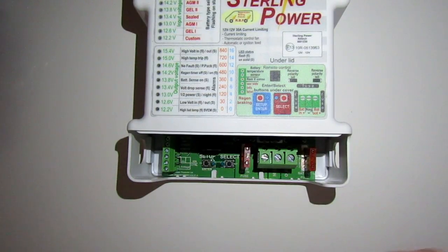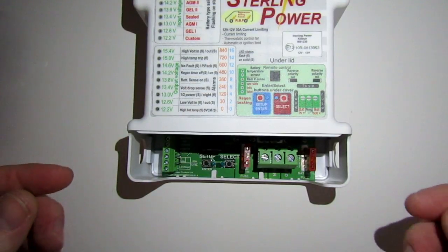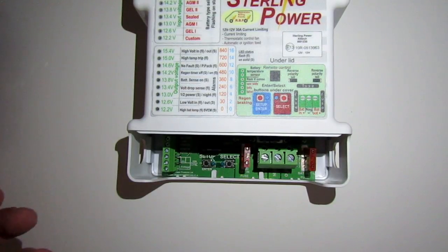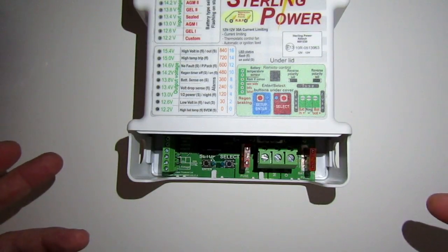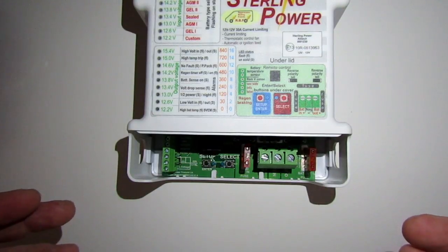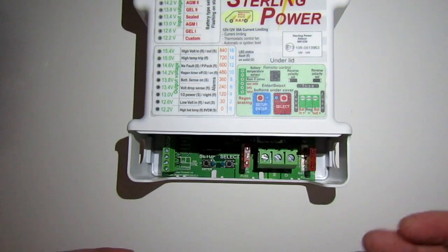Mode 3 is the mode that I use, and it has worked well. It's ignition-based — it needs the ignition to turn on, and when the ignition is switched off, it switches off. Personally, I'd rather have a system like this switched off when the ignition's off, because that's when it's supposed to work. Modes 1 and 2 will carry on working if the timer has been triggered, and for me I can see problems with that potentially draining the vehicle battery when stopped. That's why I use Mode 3.